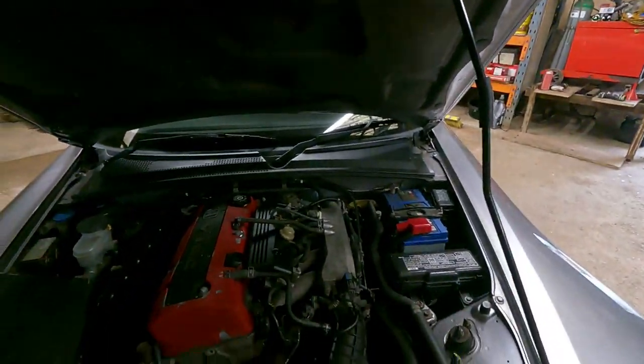We might be doing an alternator change soon. But I'm going to do a battery test first, obviously. If the alternator is doing its job, you just do a voltage test on it, turn all your heaters and your lights on and stuff. If it is, happy days, we'll just change the battery. But even the battery's like 100 quid. Is it? It's crazy, mate. It's a small battery as well, isn't it? Yeah, it's tiny. It's quite a small little battery.